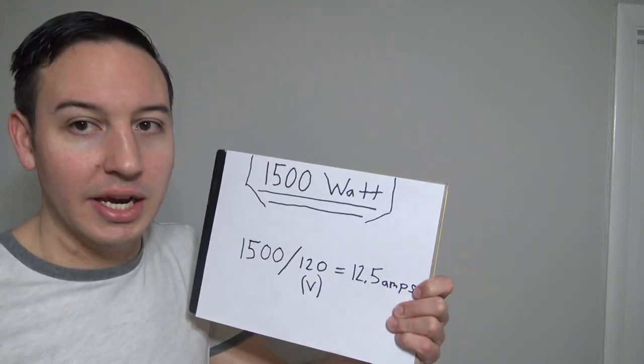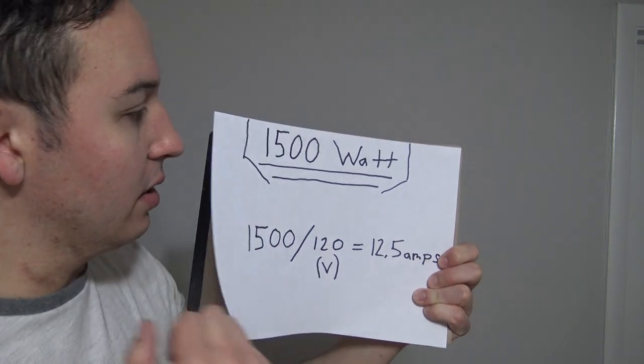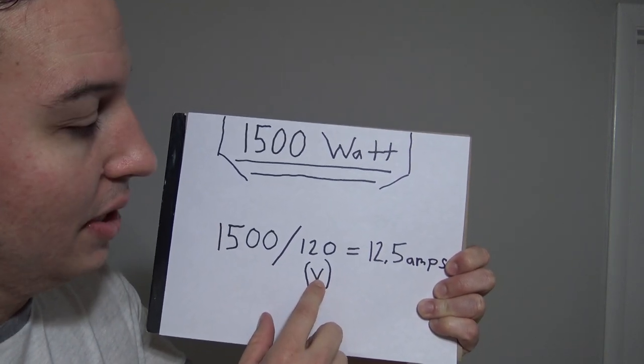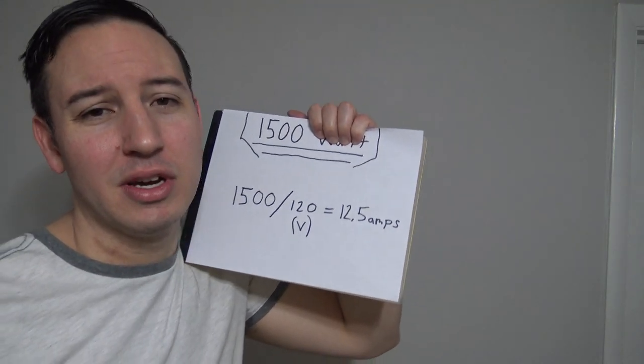For an apples-to-apples comparison, you'd want to compare the watts of vacuum cleaner one with the watts of vacuum cleaner two. The problem is that not all manufacturers will actually give you a watt specification — instead, they'll give you an amps specification. But that's why I gave you those formulas, so you can convert watts to amps or amps to watts. If I have a 1500 watt motor and I want to convert it to amps, I take watts divided by volts: 1500 watts divided by 120 volts equals a 12.5 amp motor. Amps are murky though — there's a little more work involved when it comes to comparing motors by amps. Manufacturers aren't necessarily trying to trick you, but they do give you half truths.